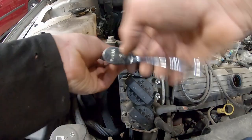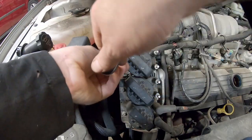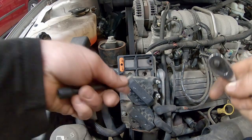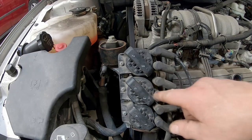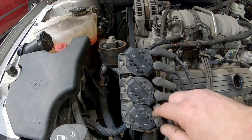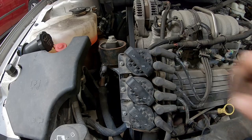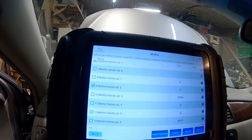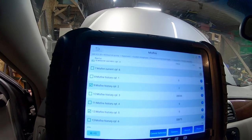Okay, here's our ignition coils. Let's get this off. This is a 5.5 millimeter on both of these. That's how the coil comes off. Now we'll move this coil up. So our misfire should show up — as far as the car is concerned, it's going to now show a misfire on 5 and 2. Let's go fire it up and see what happens. Number 3 is still increasing. We haven't gotten any on 2 and 5 yet. This is very odd.